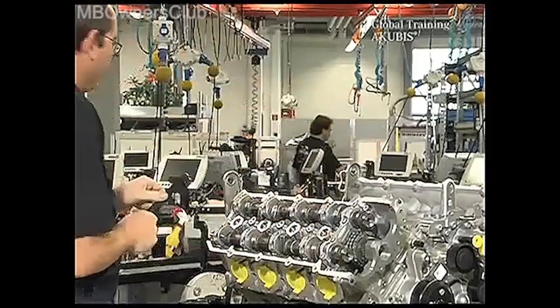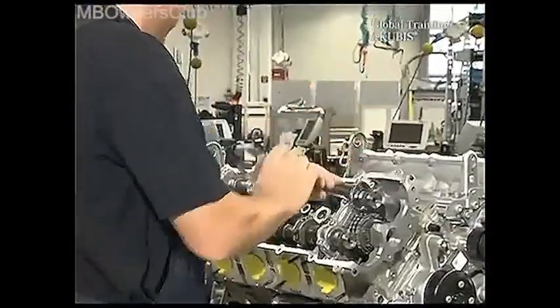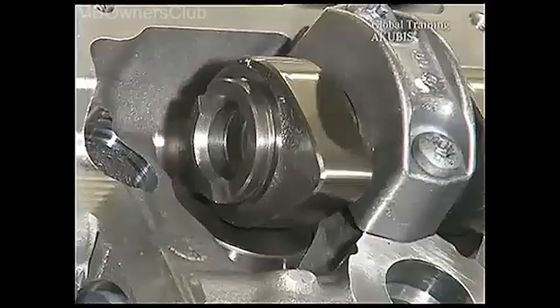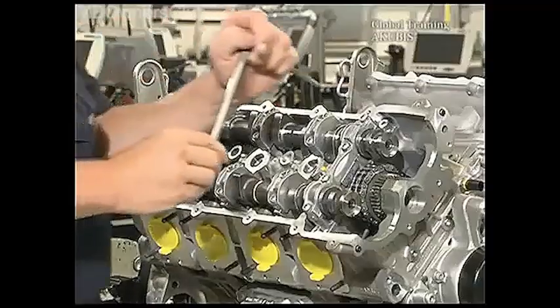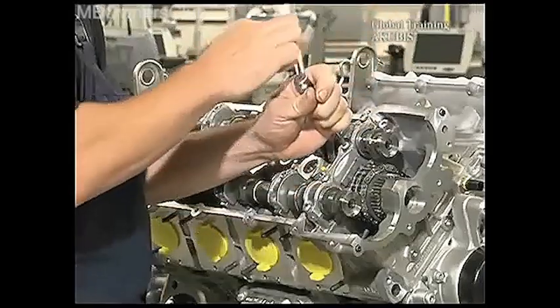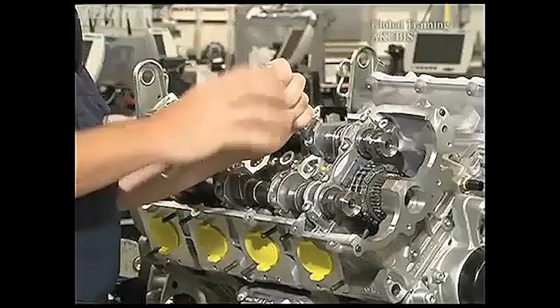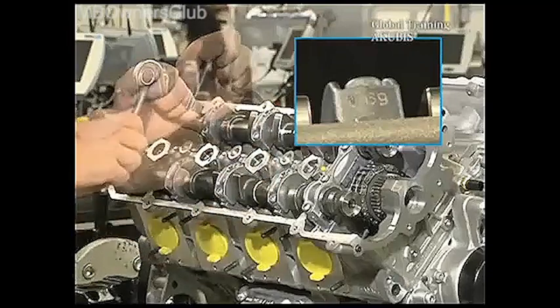Next, take off the hold device and make the camshaft free of tension — this is the case when no cam presses against a cupped tappet. To avoid damage to the camshaft, undo the screws in the bridge and the bearing liners. This needs about two rotations. Caution: the bearing liners are numbered and may under no circumstances be exchanged when installing.